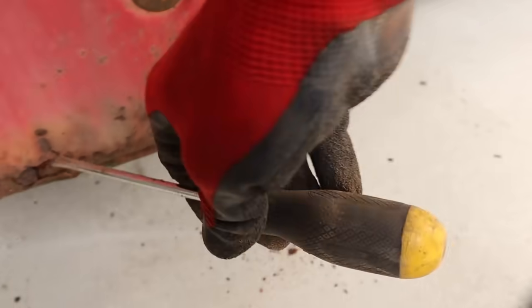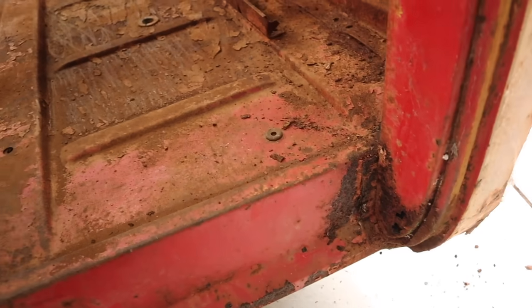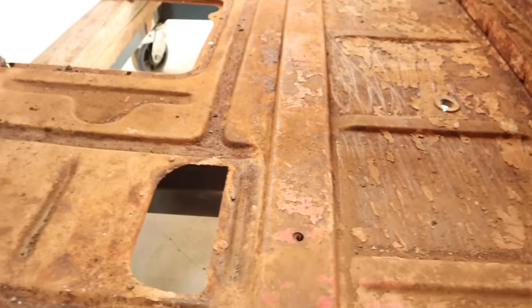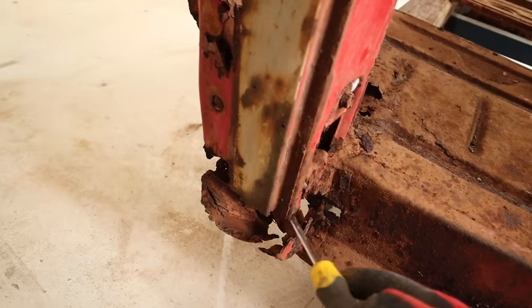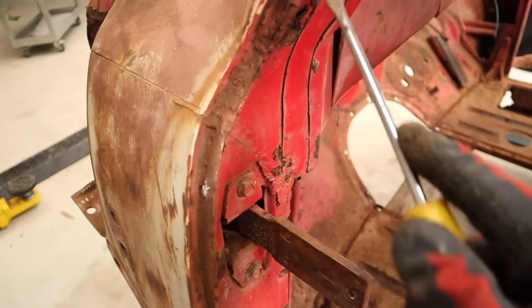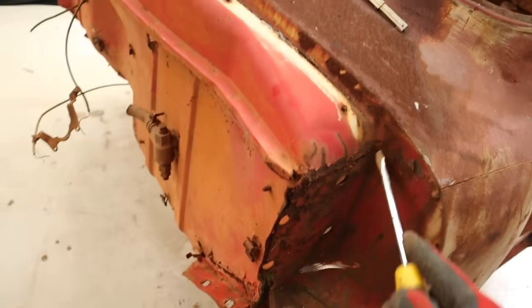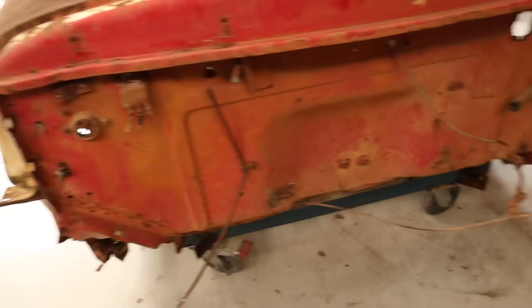There's a little along the bottom edge at the back but nothing too crazy. The bottom corners at the rear of the cab and this corner of the door has a little bit of rot in the bottom, and again around the back of the cab, but inside the floors are all solid — really good. The only real part of the cab floor that is rusted through is just a patch here. This corner again is where they all rust away, but even this bottom edge here is amazing for a truck that's probably never seen the inside of a shed in its life. There's a little bit of rot at the base of the pillar but nothing too drastic, most of the front corner looks pretty good, the firewall is all nice and tidy.